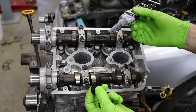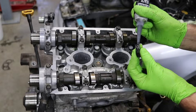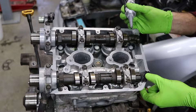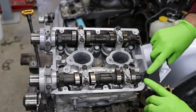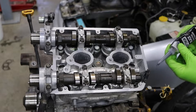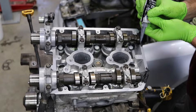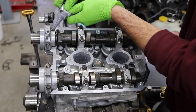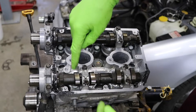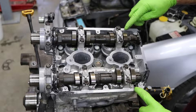I'll stop the time lapse here just to show you guys where I'm putting silicone on this valve cover. I take the silicone and run a nice bead all along the half moon gasket. Once you get a good bead of silicone on the half moon, you set that half moon into place and rock it back and forth until it's nice and flat — best way is just get one finger on each end and rock it. Once those are flat, I also take a little bead of silicone and run it right over the half moon, especially making sure to get the edges where the half moon meets the head. Then I take some silicone and run a bead along the cam caps, making sure to get a good glob right in the corner of where the caps meet the head. All this machined flat section doesn't need silicone on there.